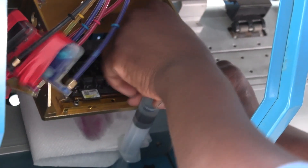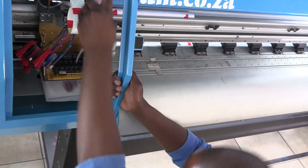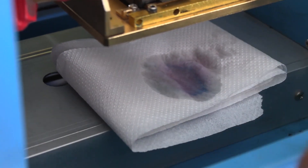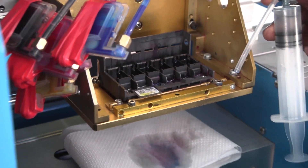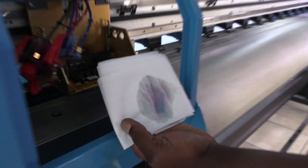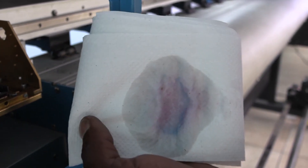Fold the pipe to stop the flow and pull out. Fit into the next chamber and push in. The moment you see some liquid coming down under the print head, that's enough shipping liquid gone into the head. Repeat the process for all six positions of the print head. You can see our paper towel has caught what came out of the print head.